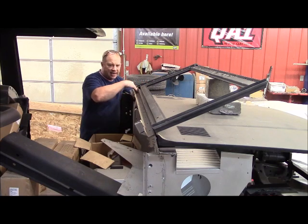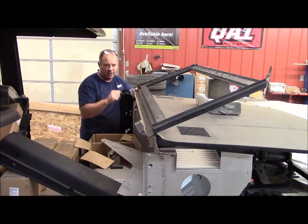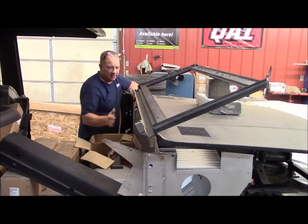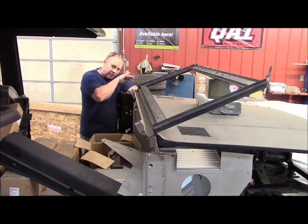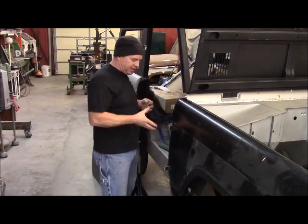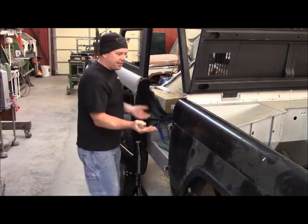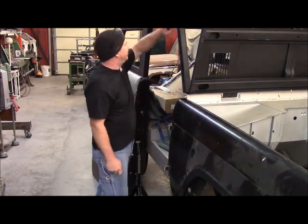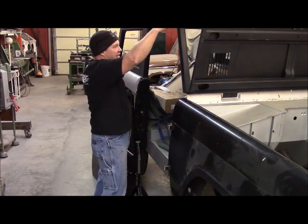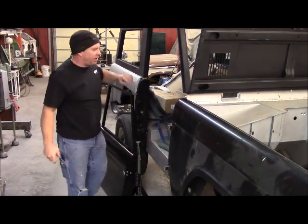I've already gone in here and straightened and dialed all this metal flat. The hinge is in good shape — I kind of pinged on all the hinge points a little bit just to get the rust out and got it moving well. I'm going to put it in place now and take that little bit of a bow out of that dash piece so that hinge plays straight when you look at it from the outside. Now that I've got it fitting over here on the table where the door strikes real nice, I can start putting it all together. I put the window frame on the door, and that's showing me this whole thing needs to come up just a little bit to get a nice reveal all the way around. I've got it a little tighter on top right now because there will be a seal and a gasket in there.